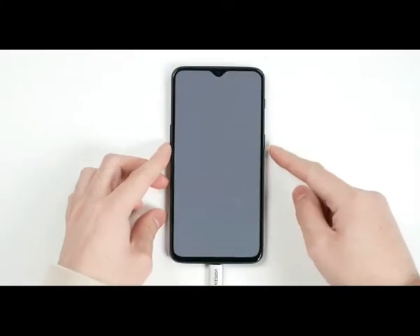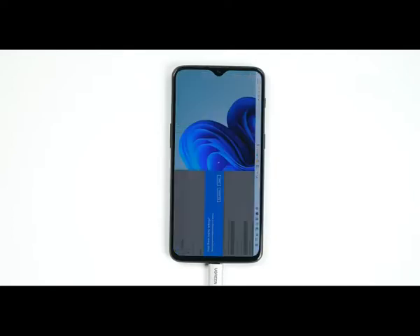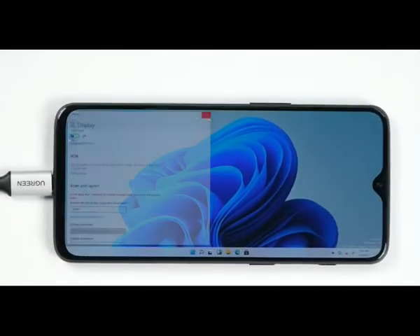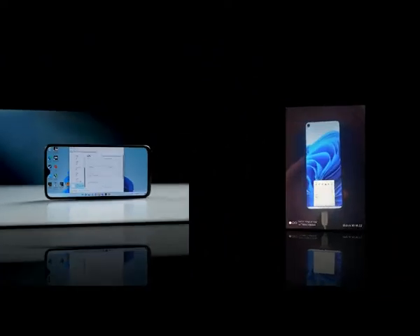This is the Windows 11 desktop on a smartphone. Look at the start menu — you can even lock the screen and swipe up to unlock. That actually feels like Windows Phone is still alive. Let's flip the screen and set the DPI; it looks much more like a PC now. Taking a look at the specs: we've got 8 CPU cores from the Snapdragon 845 chip, 8 gigs of RAM, and the GPU — Adreno 630. Looks like the GPU drivers are working just fine.